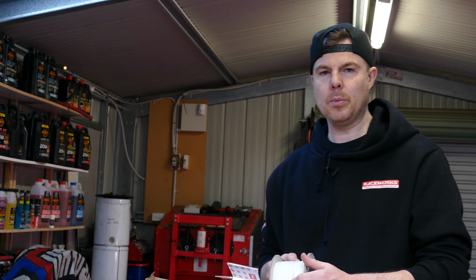So now it's just a case of applying a little bit of pressure to the trigger, and you'll feel the wires pull in. Twist it like this. We're looking for a couple of twists per inch. Now, don't chase it in because it might bunch up, but that's looking pretty good right about there.